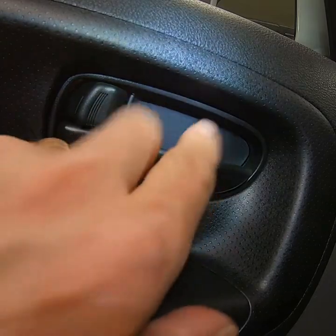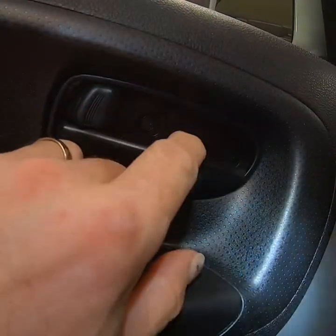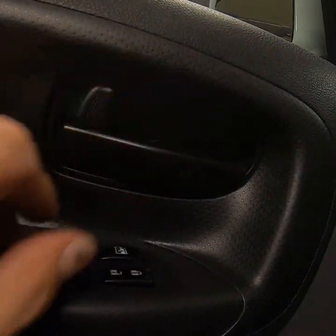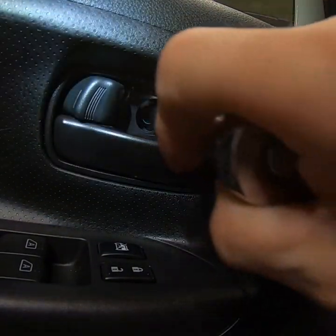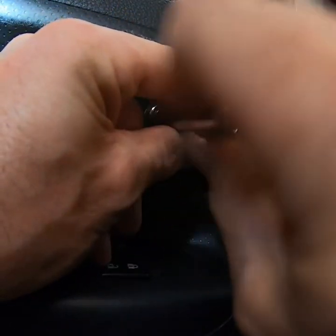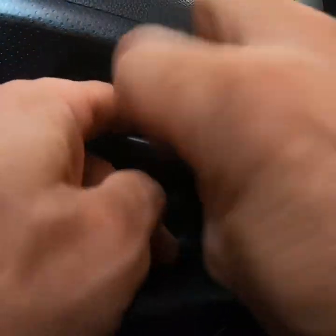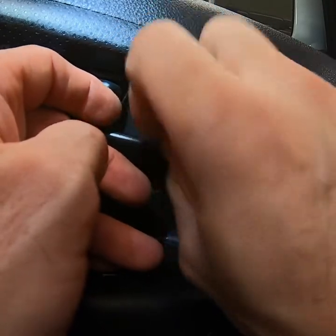The next thing I need to do is remove this panel back here. I'm going to open the door handle a little bit, put my body tool in here towards the front, and that little cover pops right off. Behind there is a 10mm bolt, so we're going to remove that next. This is a machined bolt — it should come out fairly easy. The other one behind the panel is threaded and grabbed the insulation on the other side, but this one is coming out super easy. The hard part is getting a hold of it.